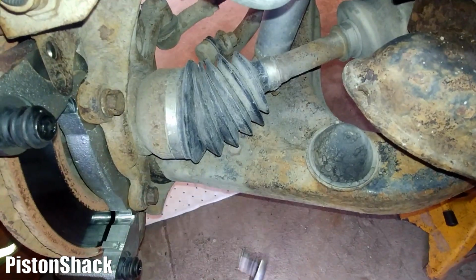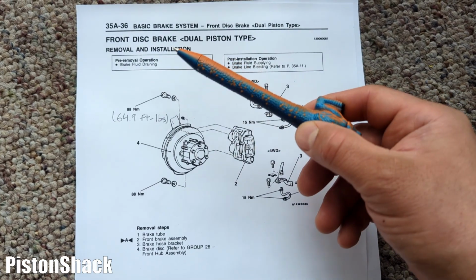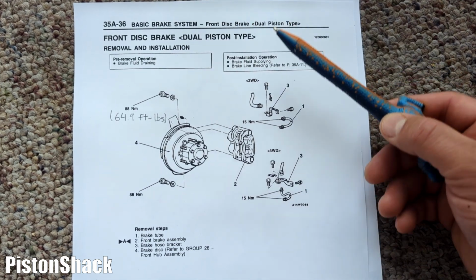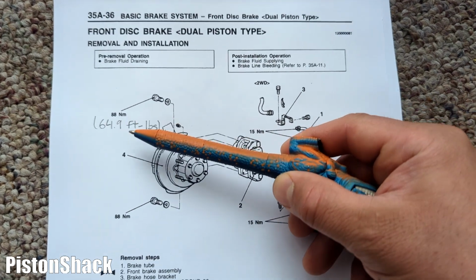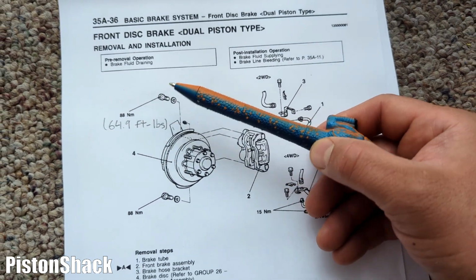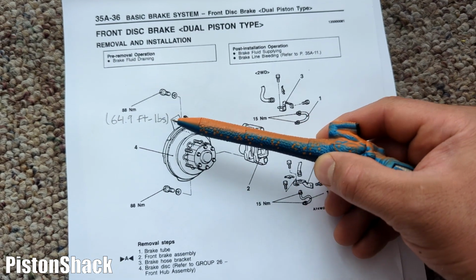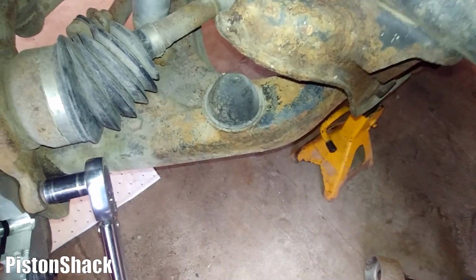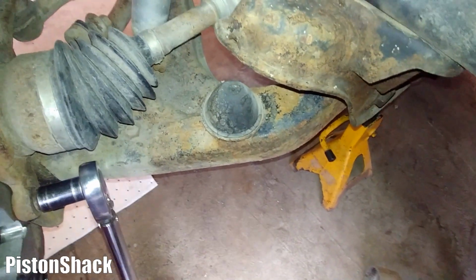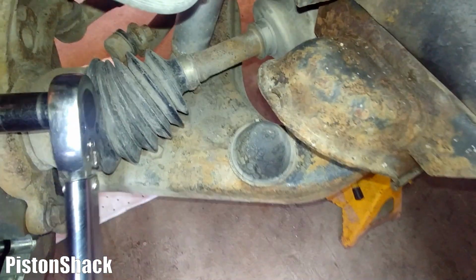Up. All right. Mitsubishi Delica factory torque specs for front disc brake dual piston type brake caliper bracket bolts: 88 Newton meters to be exact, 64.9 foot-pounds of torque. Torque specs will be down in the description below under the video. Check it out. Bottom and top.